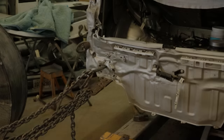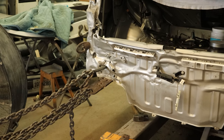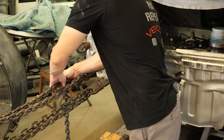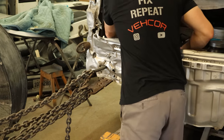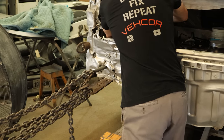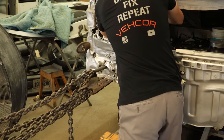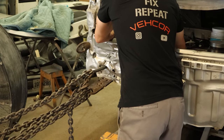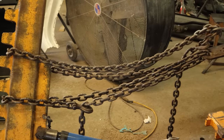Our plate is actually bolted to the bottom of the frame rail using three bolts from the other frame rail. The tow hook is just a safety in case those three bolts give up the fight and launch this thing across the shop. The ram isn't going to come out — it's going to grab onto the other chain that has a little more slack, but not enough to let the ram come all the way out. I don't want to break the frame. We got a lot more tension than before since our cylinder was leaking, so we can actually get our kinks all the way out. This is some pretty tough stuff. We're just going to keep pulling and stress relieving until we get this rail back where it belongs, or at least in the neighborhood.